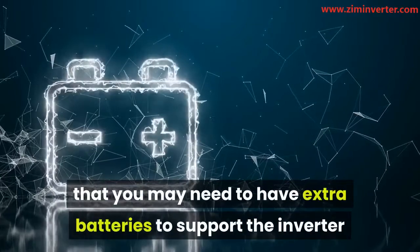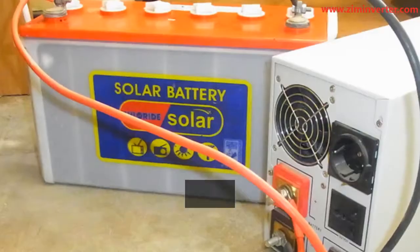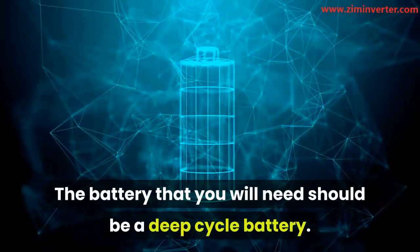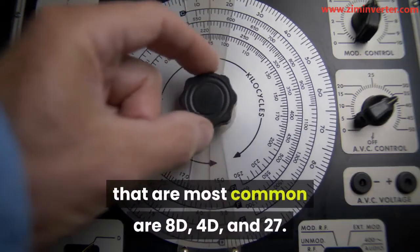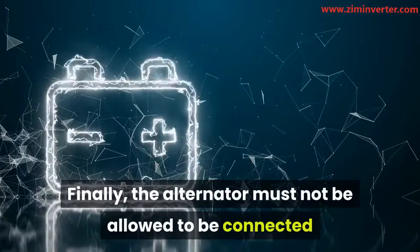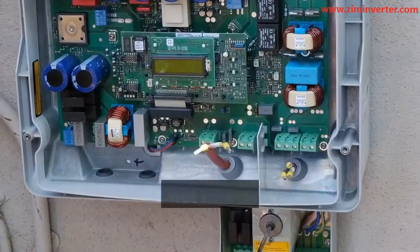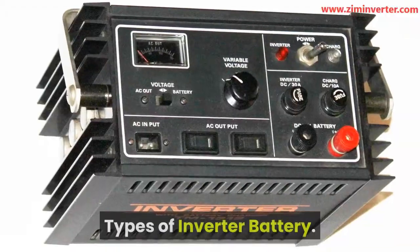Tips to help you manage your battery better: The discharge rate of an engine starter battery should not go below 90% of what is remaining. For deep cycle batteries like the marine battery, it must not be less than 50%. This caution is also prescribed by most battery manufacturers, because if the battery is used below the prescribed level, it will cause the lifespan of the battery to reduce drastically. For a battery like the ProWatt 250, it is equipped with a lighter plug to allow easier connection to loads. However, if you want to connect an appliance with 100 watts load and above, you need to make a direct connection to the battery terminal. This helps reduce the volume of voltage that would otherwise be lost while using a thin, long wire, resulting in a shorter period to get the whole system running again.